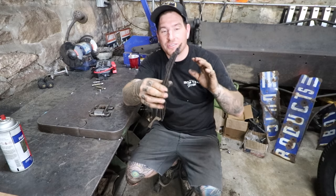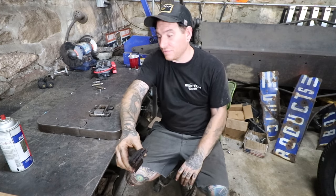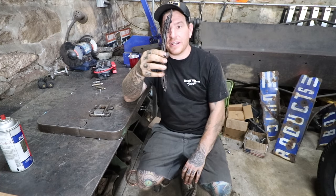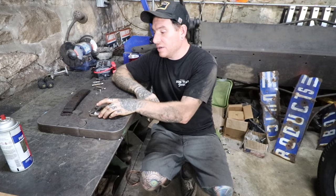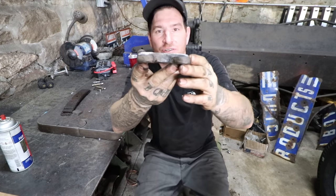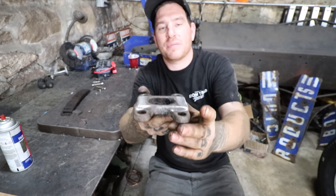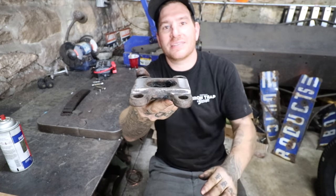The drop in the drop axle, I thought that was going to be just right, and it looks like it's going to sit exactly how I want for this car. But what I need to do is take up the thickness of these springs on the bottom end of the spring pack so that our spring clamp can actually keep the spring in the cross member tight. So you can see that this little bottom spring clamp has a little step up that actually sits in the cross member, and when you bolt everything up, that touches on the spring at these two little pads.